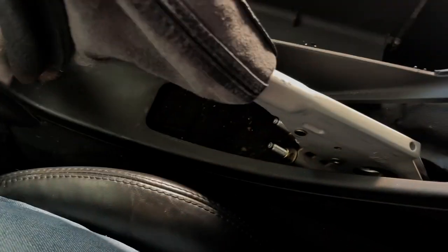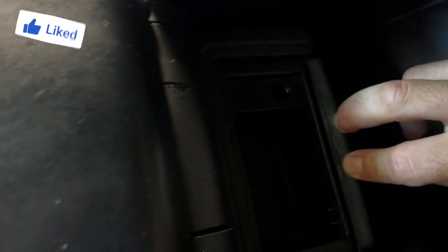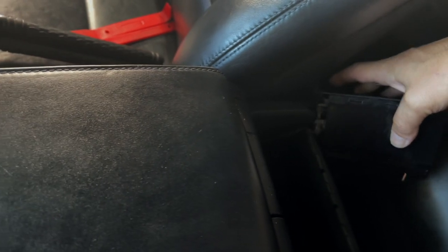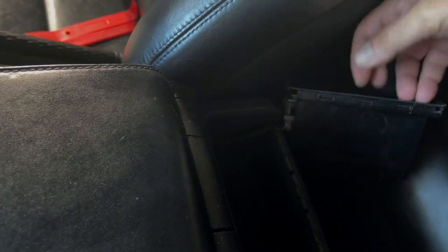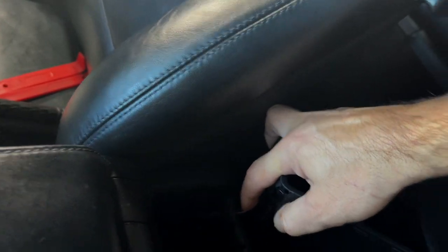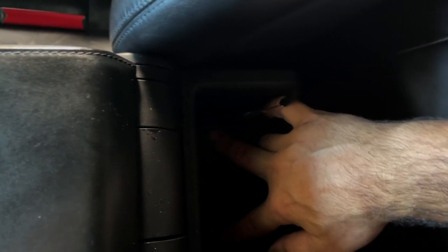I take the boot from the emergency brake up. Then there's two more screws back here. When you open this up, push it down a little bit more and the ashtray will pop out. There are two screws down in there that need to come out. Now with those two screws out you can pull this — just don't pull too hard because you have your connector for the illuminated lighting for the ashtray in there. We're going to pull that off as well — it's a little tab and it comes right out. Then there are two more screws underneath that need to come out.